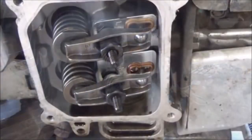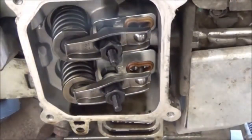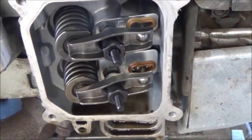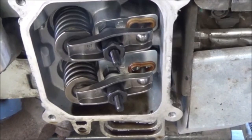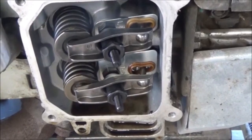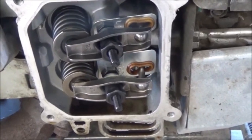Now to set the lash on these, we're going to make sure our engine is at top dead center, just a degree or two past. I'm going to go ahead and cycle this engine through — I'll put my hand on the blower shroud screen, the chopper screen, and start turning it clockwise.